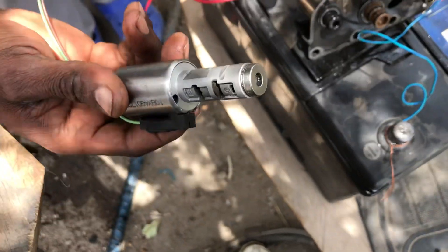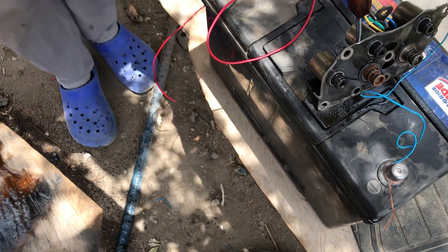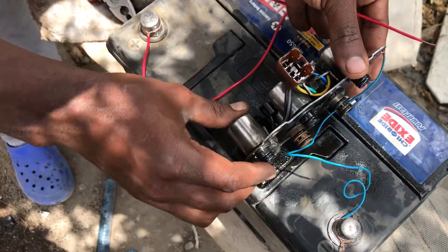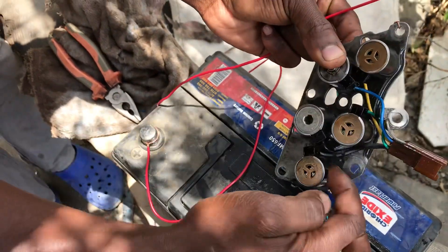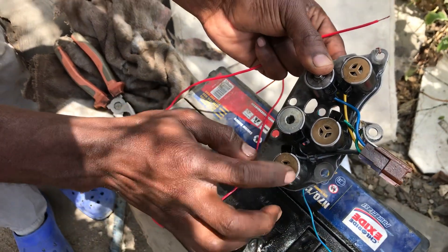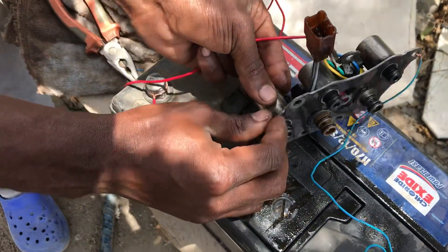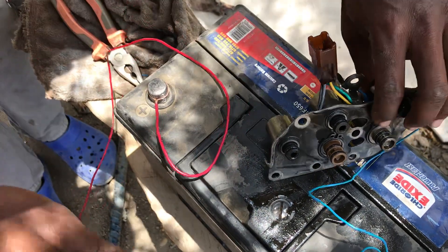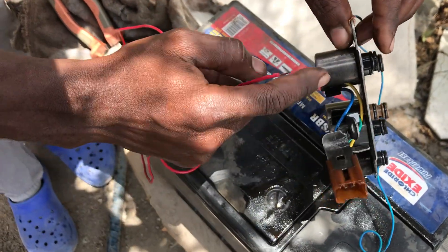I want to do a test on both the solenoids to check on what is misbehaving. The kind of solenoids that I'm having here — this has only one polarity. If I talk of one polarity, you can see only one wire. This one wire is attached to the mechanism of the car. To ascertain if the solenoid is okay, I'll have to power it up to see if I can hear the clicking sound. Let me start with this solenoid here.